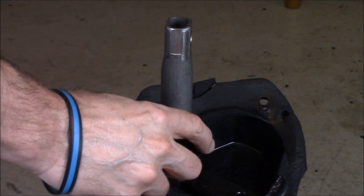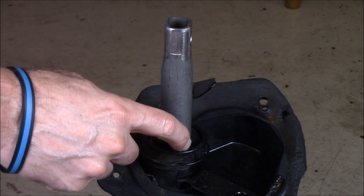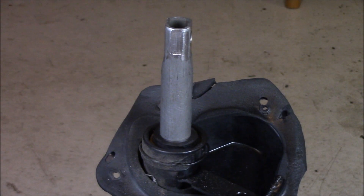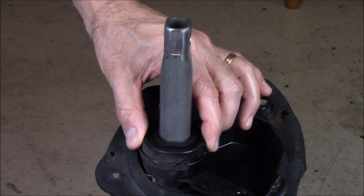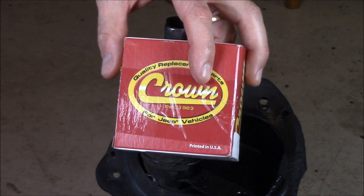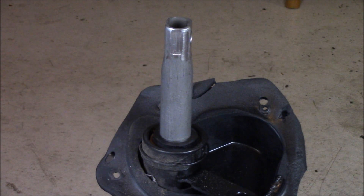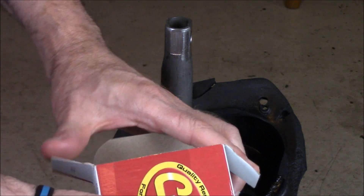So the column is upside down standing on the floor and the shaft comes out — this is where it connects to your intermediate shaft and goes to the steering gear. This is the back bearing that stabilizes the back end of the shaft. On G-Bodies and probably other GM vehicles as well, it's just a rubber bush on either side. I'm going to replace this with a Crown kit — there's the part number. This kit fits on the Jeep CJ and YJ Wranglers from 1976 to 1995. You can find this on eBay for about $23 to $28 depending on where you get it.